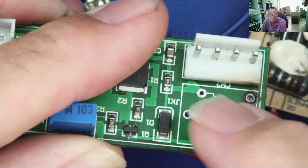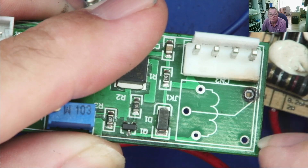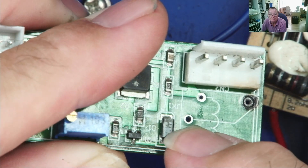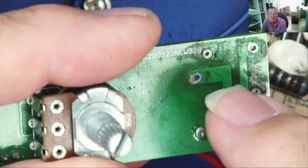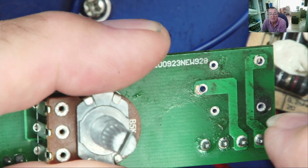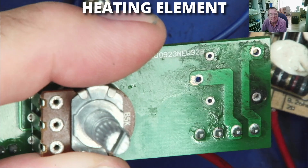This symbol shows the coil and the contact - this is a single pole double throw, so it switches either to here or to here, this being the common switch terminal. But looking underneath, that one isn't actually used. So the only contact used is common and that one - it switches the live coming in here to the element connecting there.